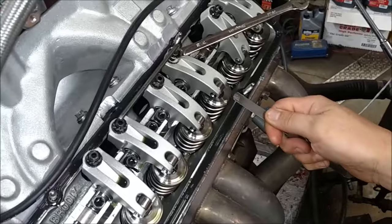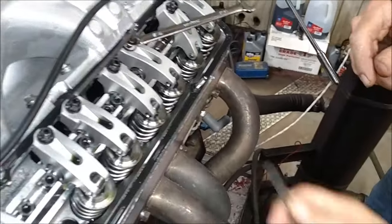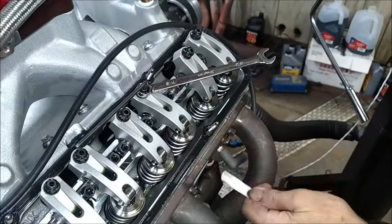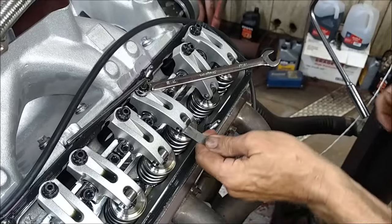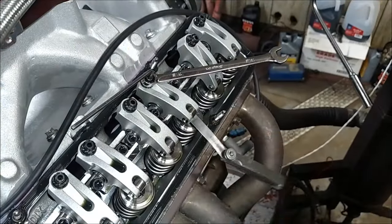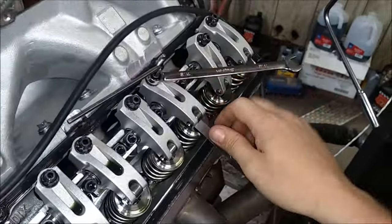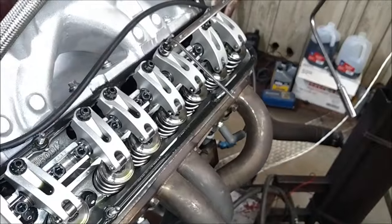Now that's a little bit loose — let me feel it. I want to tighten that up a little bit. Put the feeler gauge back in, and now I'm going to turn both of them together. All right, that's about like it ought to be — tighter. You see how I did that? You tighten them together. Now you do it.